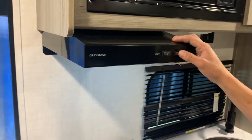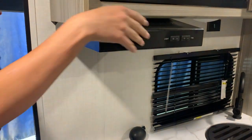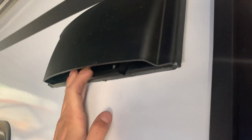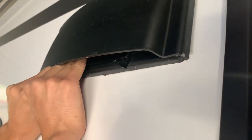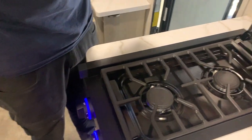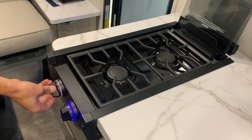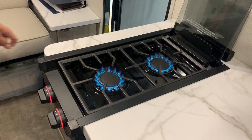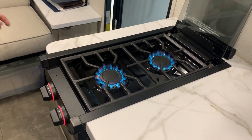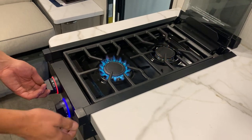In the kitchen area you've got your range hood, which I do recommend running whenever you're using the stove. There is a little flap right outside the door — always make sure whenever you first get to your campsite you've got that flap opened up so you can evacuate those fumes. Whenever you're traveling, just lock that into place so you don't get any excess dust inside the unit. This stove runs off propane, so be mindful of that. You've got a glass cover — just pushing it over to the light will fire it right on up. Sometimes it can take a few minutes if you've had the propane system off for a while, to clear all the air out of the lines.